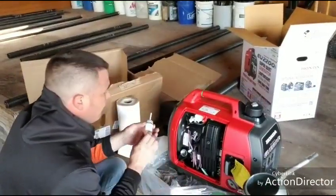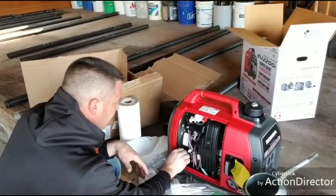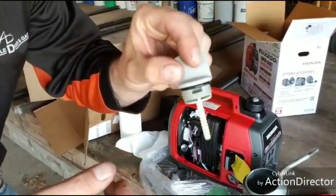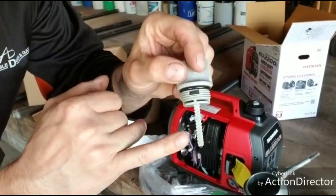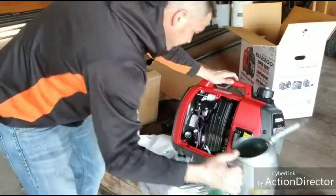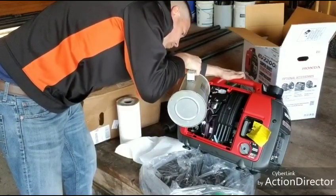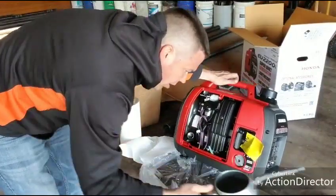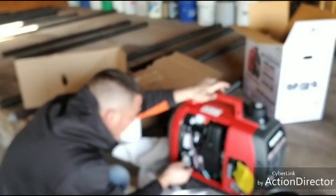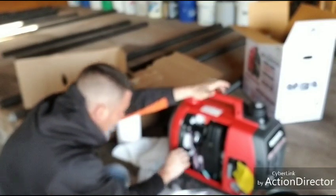Alright, I can start seeing it, so let's go ahead and check her out. First, just plug her in there, and she's showing a little bit on the dipstick. One thing I'd say that kind of doesn't explain anything is that if you look at the dipstick, there's no high, low, medium, there's nothing. It's just got like, hello, put me anywhere and I work. So you might as well just kind of get her to the full. There she be. About ready to come out the old dipstick tube there. So I'm going to call that full.